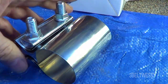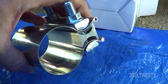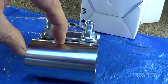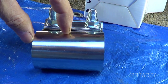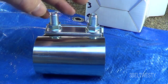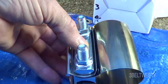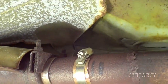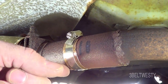This clamp seals a pipe that has a hole or a cut in it, and it's somewhat structural because it's three inches wide — some are three-and-a-half. You take it apart, wrap it around the pipe, and tighten it down to 48 to 60 foot-pounds.